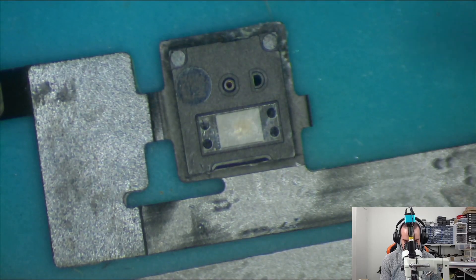The tricky thing is because the flood illuminator is all corroded and we've got a working phone, there are two things that can happen. We can just replace this whole thing with an aftermarket one and essentially the customer loses Face ID, or we can attempt to repair this one. The ambient light sensor and the flood illuminator are paired to the phone's Face ID, so without those unfortunately we won't end up with Face ID. Let's try and fix this one first, but worst case scenario the customer loses Face ID.